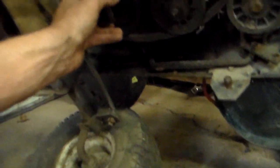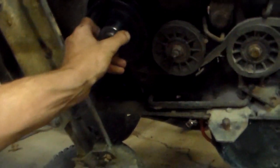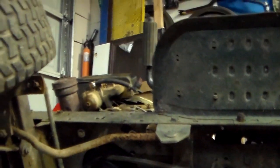I think it's 1 inch for the engine and I think 5/8, don't quote me on it, for the transmission, give or take. That's the pulleys I run. 5 up front, 6 in the rear, and it seems to work out just fine for me. It's a little bit much for an 8 horse, but it's not bad. Now I'm getting ready to set up the belt.